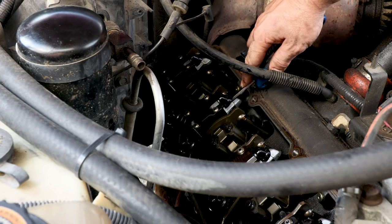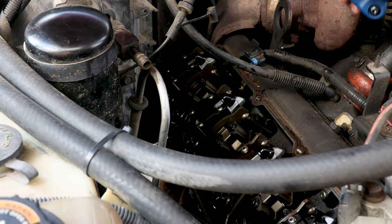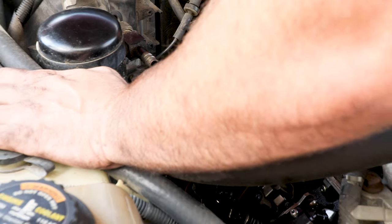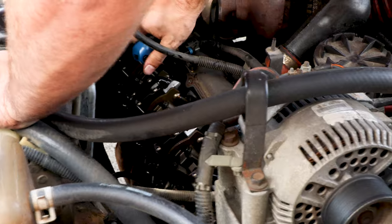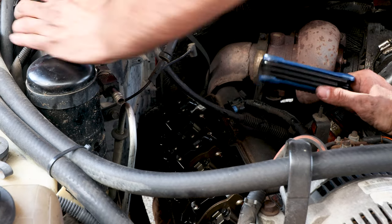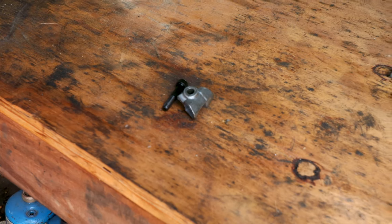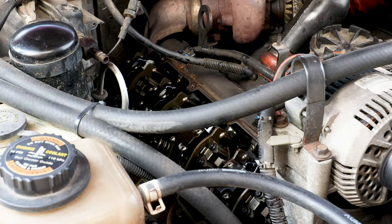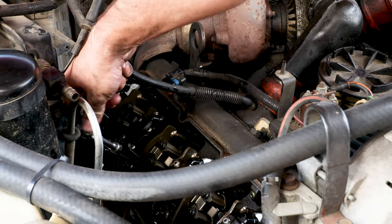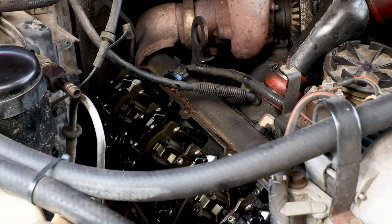These little things here are the oil squirters — this is where the excess oil comes out of the injector after it's used to compress the fuel. It dumps out of this little squirter. You have to take it off first; you will break it if you don't. It's a number five millimeter Allen. Now that we've got the oil squirter off, there is a bolt here — it's an eight millimeter — and a bolt here. We want to take the back one off. It's not a real big bolt, so keep that in mind when putting it back on. Don't strong-arm it and break it off, because it will be a pain to get out. I have broken one before using those German torque methods — good and tight.